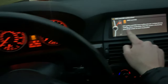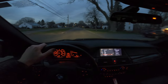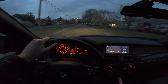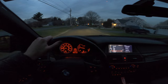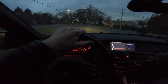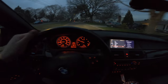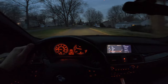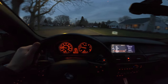It looks like we're good to go. Let's start up the car and see if that four-by-four warning and all that goes away. As soon as I put the car in drive and the wheels rolled forward a few inches, the DSC and four-by-four lights turned off on their own. To be sure, I went back in with the scan tool and erased the stored codes. These two warning lights commonly display on an E70 X5 when the battery is disconnected for any reason, basically because the computers have lost power temporarily. If this video was helpful, please help me continue to make videos like this by subscribing to my channel and hitting the notification bell. Thanks for watching and I'll see all of you next time.